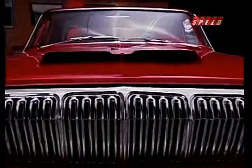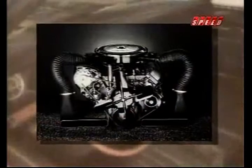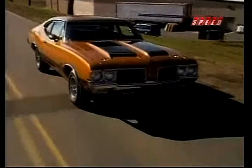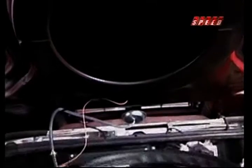Normally aspirated engines really respond well to cold, clean, ducted air from outside. It's a theory that most of the factories used when they came out with big, hairy hood scoops during the muscle car era. Well, that and they look cool. That's the whole idea of ram air. Cold air at the highest possible pressure. The colder the air is, the more power you'll make. From Mopar's massive superstock scoops to Chevy's cowl induction setup to the Oldsmobile 442's trick under-the-bumper plumbing, all the coolest muscle cars had some method of getting cold air into the intake manifold.